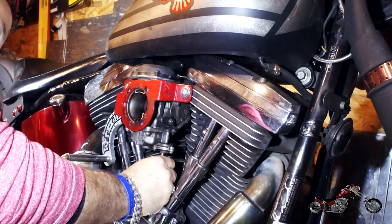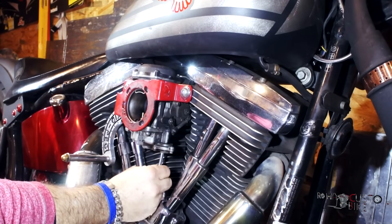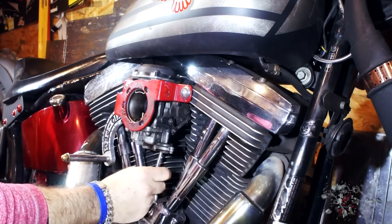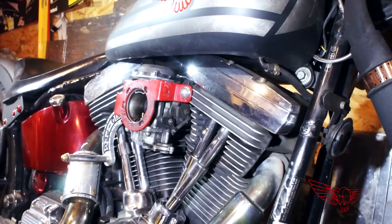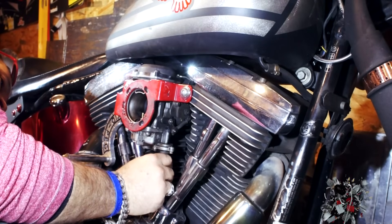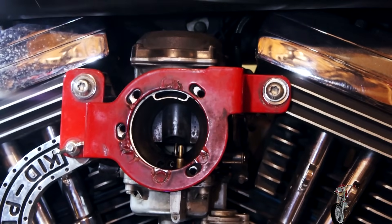I start by turning the screw clockwise — this reduces the amount of fuel going through the system, consequently leaning the mix. The engine will stumble until it shuts off. Now I get back to the starting point of one and three quarter turns and I try turning counter-clockwise to see what happens. Since the airflow is a constant, we'll try to obtain the best and most efficient fuel-to-air ratio for our engine. By turning the screw counter-clockwise we are letting more fuel through the system, and as you can hear, the engine revs up. This seems to be the point where we have the highest RPM. I add another half turn but can't detect any noticeable difference, so I go back to the point where the turning stopped making a difference. Let's twist the throttle and see if it feels responsive enough or if we still get some hesitation. The goal is to have the highest number of RPM at idle and at the same time have a responsive throttle. By going back and forth with the screw in very small increments and keeping track of the turns while twisting the throttle, you too can find the spot where your bike runs its best.